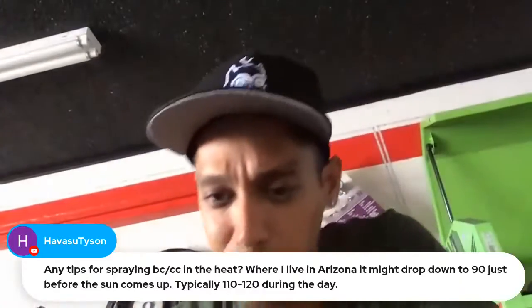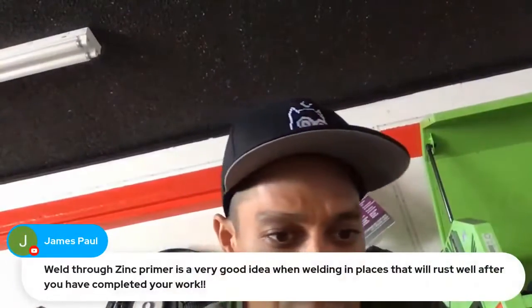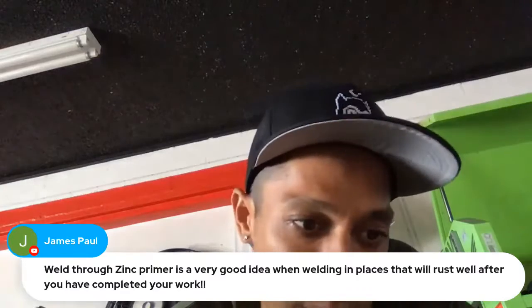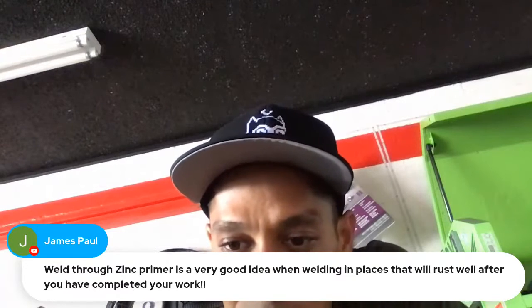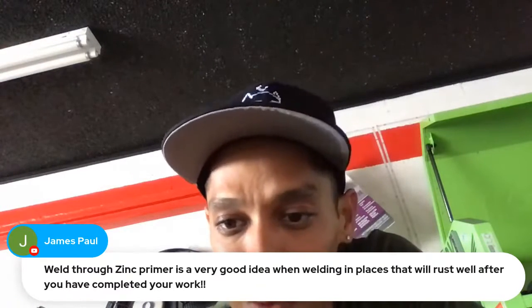Quick little Autobody Q&A. Weld-through zinc primer is a very good idea when welding in places that will rust after you've completed your work. So there you go. James Paul answered your question. I just haven't been doing much welding lately. And when I do, I just use epoxy primer right over it.